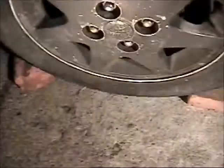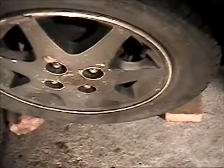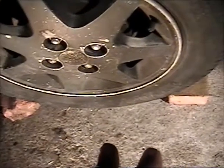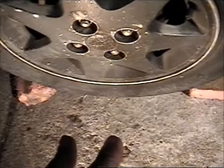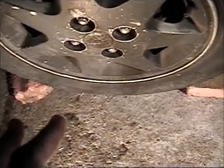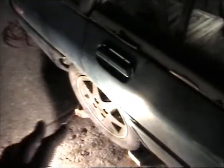I have these bricks here to stop the wheel. Like if you're working on the front left wheel, you block up the rear right so that it doesn't move, because when you jack it up the car is going to lean to one side and all the weight is going to be on that one tire, like on this tire here for example. And that one won't move.